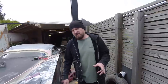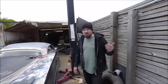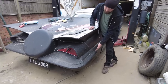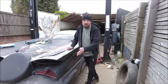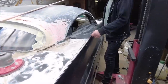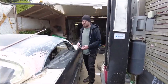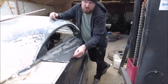So another bit on Dualatron that I never really liked - and don't get me wrong, I do love this car. I think it's amazing, but just over the years I've learnt more stuff. One bit I never liked was this rear corner. To me it looks like it's a box with bits cut out to make the shape, and I never thought the wing was quite wide enough. The wing needs to be like the widest point, probably as wide as the bumper. And the wing comes down and then drops in at a steep angle, and I've been thinking why didn't I bring it through and then down to the front of the door? This is a much straighter, smoother line, and this is a perfect time to do this because there's a lot of cracking in the door.